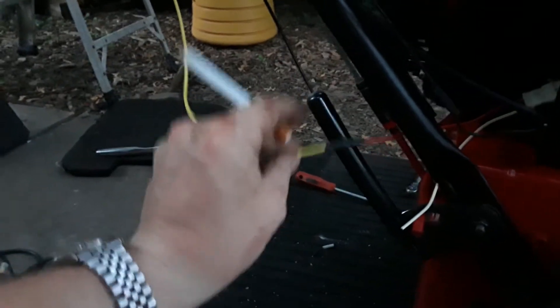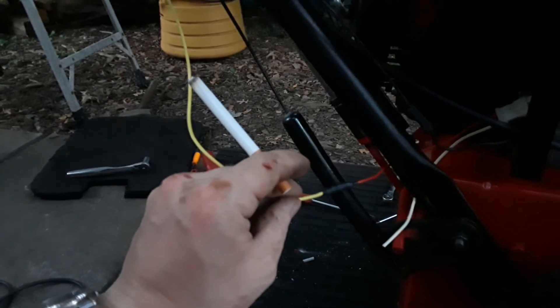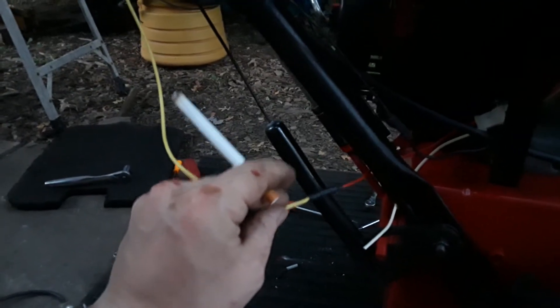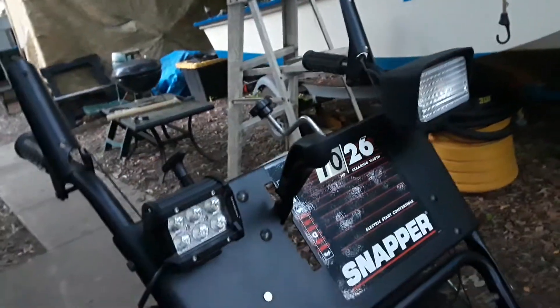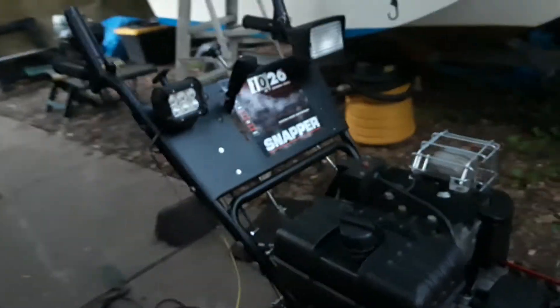I mentioned in my previous video back in March exactly how many watts this thing can handle. I'll put it down in the description so you can go to that video, because in that video I mentioned all the part numbers, all the different stators, exactly how many watts it can handle, and everything. As long as you stay under — and I believe it was 76 watts — you're fine. This light draws, I believe, 33 watts. That other one's even less — let's say a total of maybe 50 watts. It can handle up to about 77 watts, which is 3 amps. Just tune into that other video to get the specifics on that, because it's been a while since I went over that, but I know I'm covered.